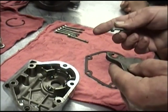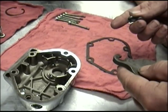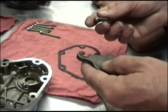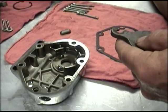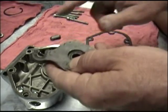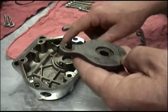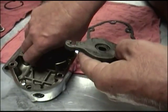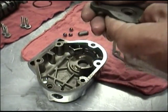Okay? That worked okay. Harley-Davidson decided they had to do one better in the aftermarket in order to sell their product over the other guys, because they wanted more money for it. Now Harley makes a kit where they give you a different main clutch spring, correct me if I'm wrong here, and they give you this and this, okay, and the angle that these slots are cut down in here are different.